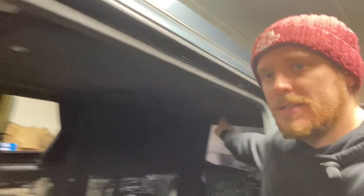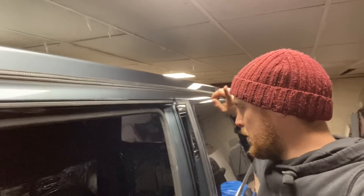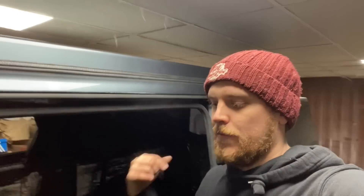We are actually going to be heading over to Car Electronics to get all this lot fitted. I've already done a little bit of wiring — we've pulled the speaker cables in because we're going to be putting some speakers in the back. We've pulled the reverse camera cable in from when we fitted the tailgate. We've pulled a power from the rear lights up so that we can power the camera via the reverse lights, or we might put them on the side lights. We'll speak to Paul about that one.